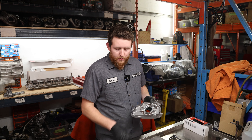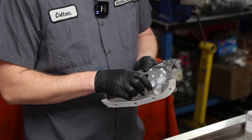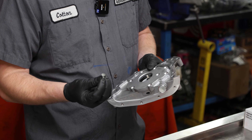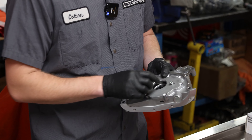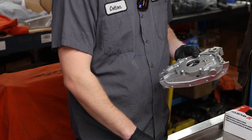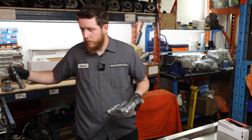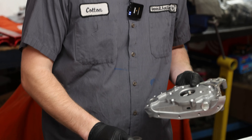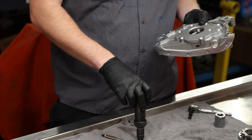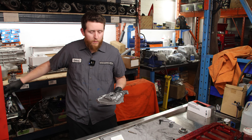Now that we've got the back panel off, we're going to remove the pressure relief valve. The back panel can be kind of annoying — sometimes these bolts are quite tight. What we usually do is use a Phillips bit with a ratchet to get enough leverage. If that doesn't work, we use a tool that lets you hit it with a hammer while putting downforce, and then turns the bolt, so you can end up with an easy removal instead of fighting it or ruining the screw.